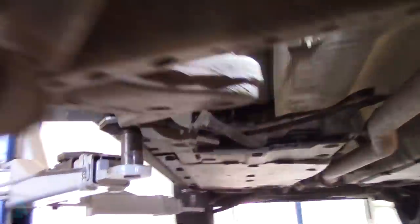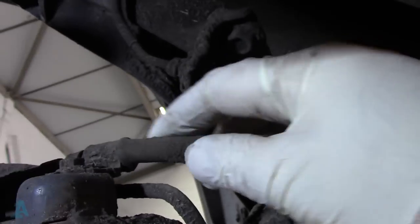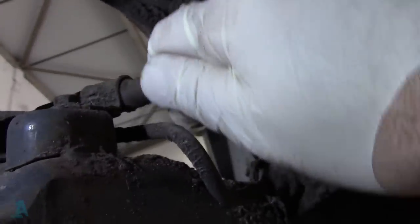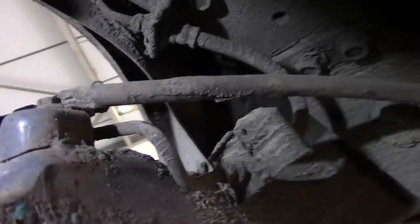I've taken the wheel off. Just notice the cable coming in from the top. I've done these cables before on Qashqais and it's always this left-hand side one — or the ones that I've done, unless that's just me being unlucky. Just there, right where this bracket is, you can see that it's broken. That's the outer cable. You can feel there that that cable is broken and it's not doing anything. So I'll get some cables ordered. I'll see what the customer wants to do — whether they just want one to get it through the test, or whether they want to be a bit preventative and get the other one done as well.